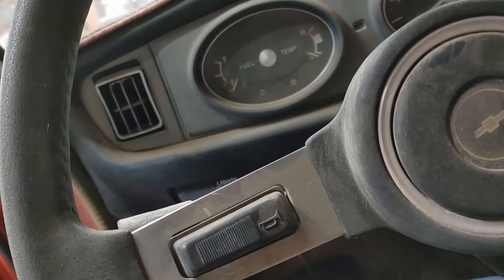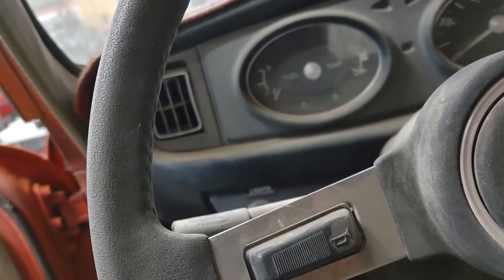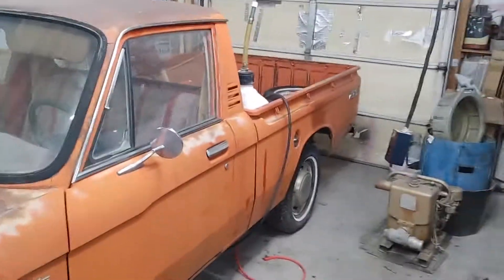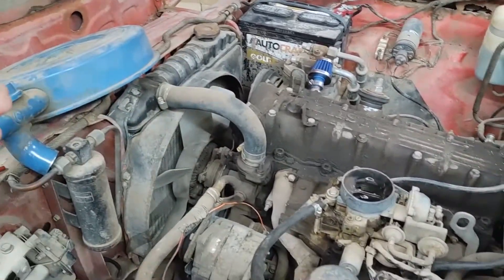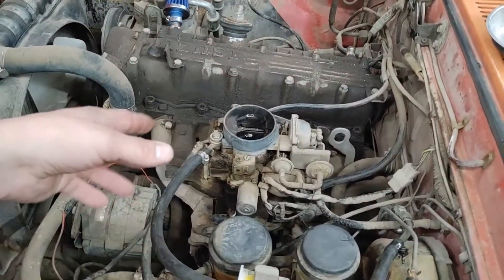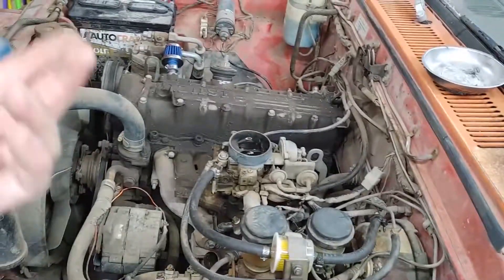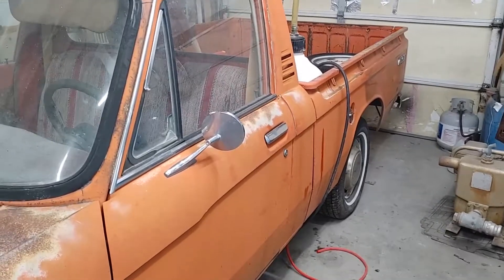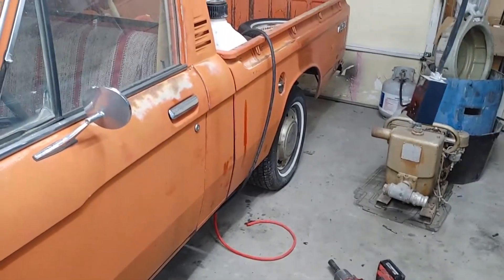The brakes — there's some pedal there. The clutch is absolutely nothing there. Brakes need fluid. But she runs — that's a good sign. We've run it off gas can gas and it runs. Most of it I think is the carb. It doesn't look like the accelerator pump's doing anything. I think if I pump the idle up, maybe get the idle going, and ease on the throttle, I can drive this thing. I won't have a carb kit for this thing until the weekend. If I can get the master cylinder swapped out and the brakes bled, I'd like to drive this thing even if it's not running quite right. The plan: disconnect, drop the gas tank, see what condition it's in, dump the old stinky gas out, put it back up, install new gas lines on the way there. We'll get after that fuel tank next.